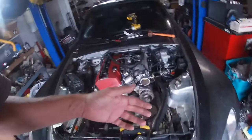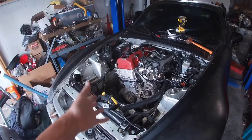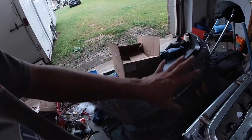To do these properly you're supposed to drop the oil pan, but I kind of just squeezed it on in there without doing that. If it does leak at the bottom, no big deal, because I am going to take the oil pan off later on. Right now we just need to get it running without it leaking. I didn't put this thing all the way back together — when checking something like this, don't put it all the way back together, crank it up where it's at. That way if it does end up leaking, there's a lot less stuff to take back apart. Also, we went south and picked up an FD, we'll show that one later.